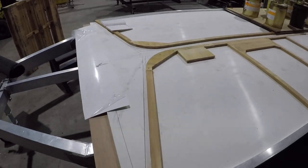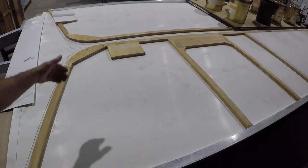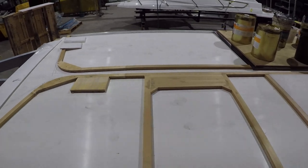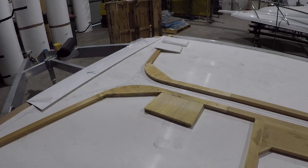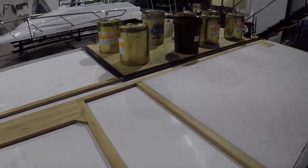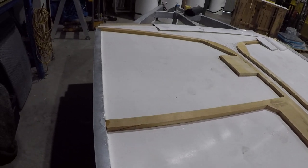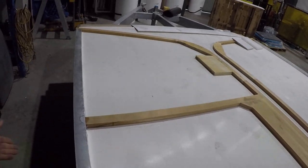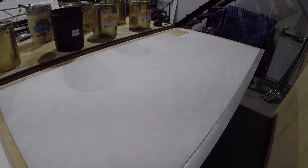I've drawn out the sides of the caravan - this is only the top 1,200mm of side. We've got western red cedar packing around where the door is, and some plywood packing where the awning will attach to. On the bottom edge I've glued on some aluminium that will then be riveted or screwed to the aluminium framework on the chassis.